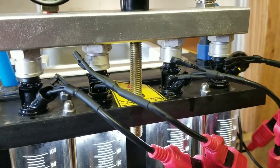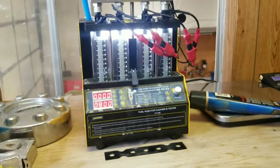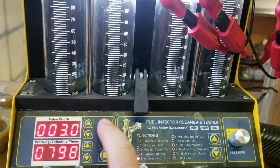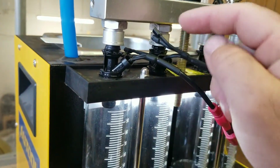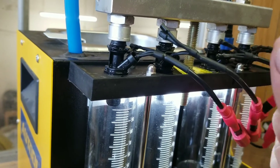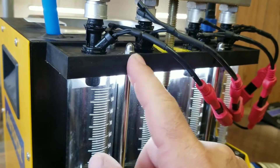I'm gonna see if I can fix it just for the hell of it. These things are 90 bucks a piece. Usually I just use this machine for diagnostics, and this is a really good example of how this thing helps. Because the thing is, you can click these injectors, hook up pressure to this and click it once, and this thing's gonna turn on and it's gonna spray fuel. You're gonna think that that injector is good, and you're gonna chase your tail.